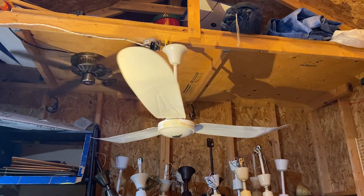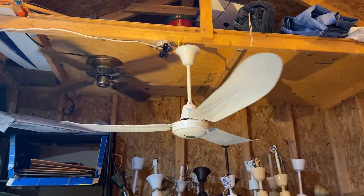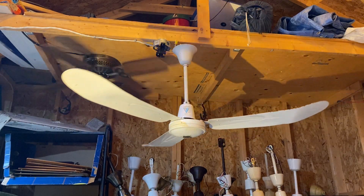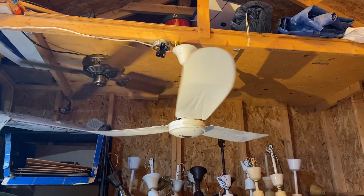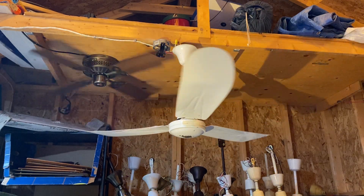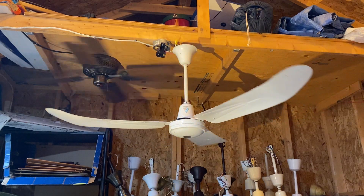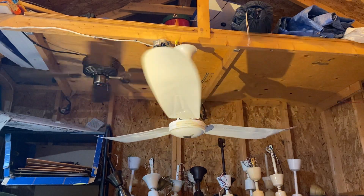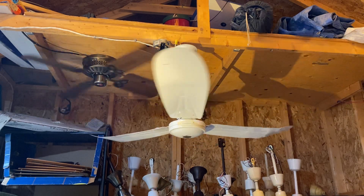I think it's going to keep going. The blades are also pretty bent, but the fan does not swivel as much as I thought it would. The blades are also very, very heavy — they're very heavy steel. These are known to get bad capacitors because for a not-so-big motor to drive three heavy steel blades, it gets the motor really hot and the capacitor just wears out.